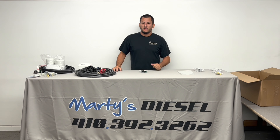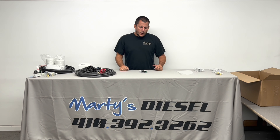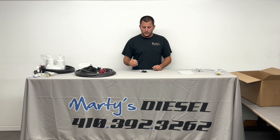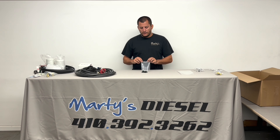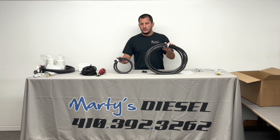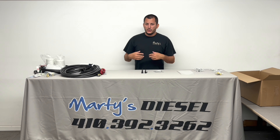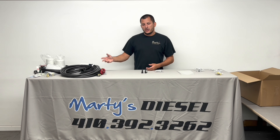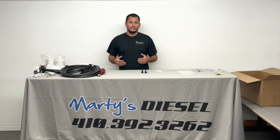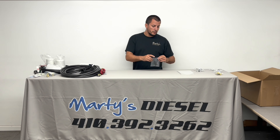If you want to get rid of the selector valve — maybe you have a bad selector valve, a bad side tank, or you just want to run one tank — always leave your selector valve at least plugged in even if the fuel side isn't working, because it controls your fuel level gauges. We also offer a single tank conversion. You add 10 feet of line to each of these hose assemblies. Instead of 90-degree fittings, they will have straight fittings in the correct size to click directly onto your sending unit. The extra 10 feet is so you can do it on a crew cab long bed with the rear tank. If you're doing a regular cab with just the side tank, you'll have extra line left over — not a big deal. I send out more than enough to handle the longest truck bed configuration.